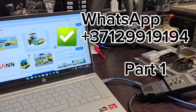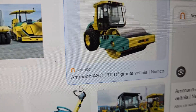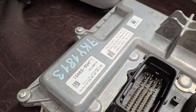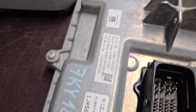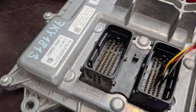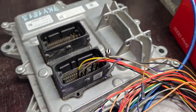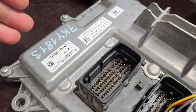Hello everybody! Who likes the big machines? This one has a Kubota engine in it, and we have this kind of ECU - look, it says Kubota, it's a Bosch ECU. This one is the EDC-17 CV-45. Yes, CV-45. We already connected, so if you need the pinout for this ECU - Bosch EDC-17 - we can definitely guarantee and get you any of these solutions.